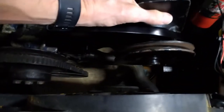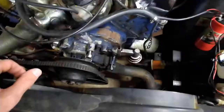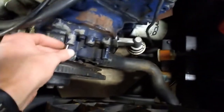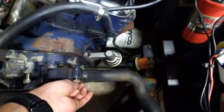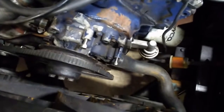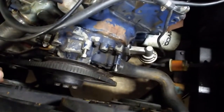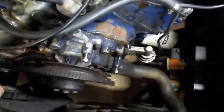That should theoretically sit in there like so and then pivot in and out. However, these two bolts just don't want to go in — they go in literally half a turn and then stop. Chances are this water pump is full of paint and the threads have never been chased out. Actually, this is a motor from a power steering car, so you would think it would have had brackets hanging off it — but we'll experiment and see if I can chase those threads out.